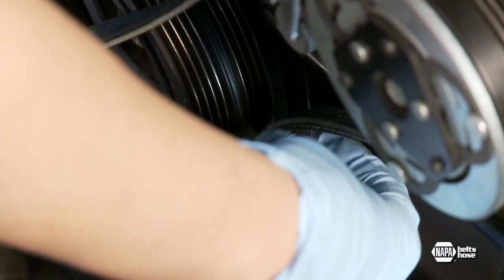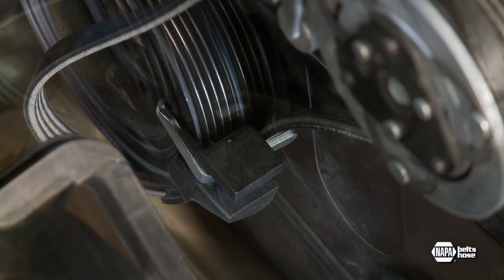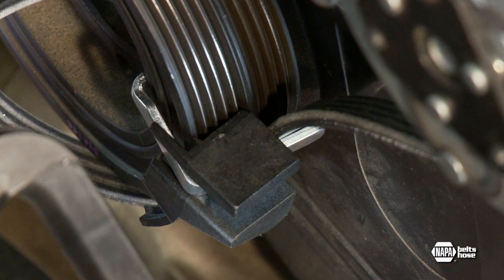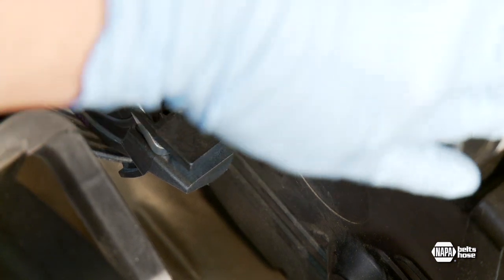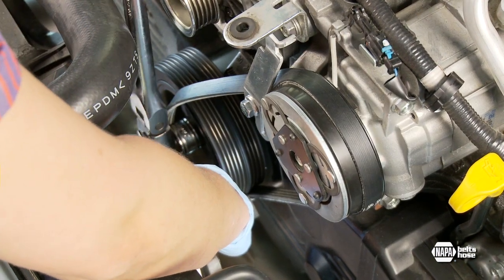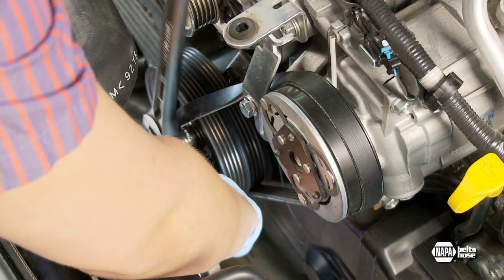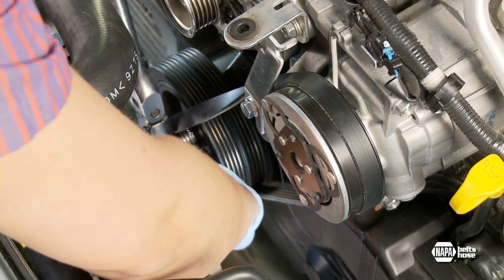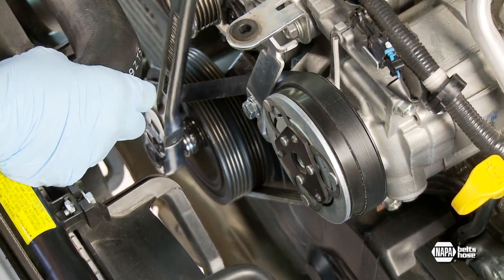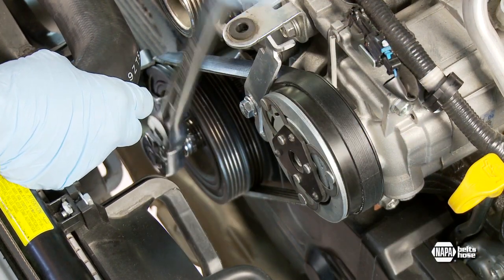Now, route the belt down under the long arm of the U-shaped belt ramp retainer. Pull the belt over the belt ramp tool edge that is on the top of the pulley. Make sure the belt ribs are properly aligned in the compressor pulley grooves. Rotate the crankshaft clockwise as you guide the belt around the pulley by allowing it to slide over the installation tool. This will be a very snug fit and seem as if the belt is too short, but keep turning the crank.